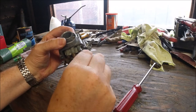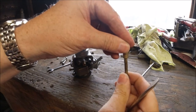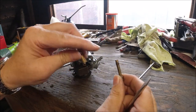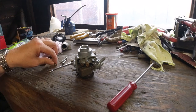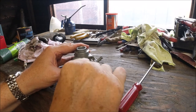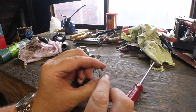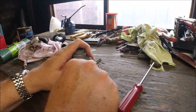The plunger basically does this — that's no choke — and as soon as it moves off, it lets air in and brings in fuel mixed with air through that hole on the side, giving you more fuel to start. Most jets are 45s or 50s — I'll have a look: this one's a 50. Then you've got your main jet in the middle and your pilot running jet, and depending on which Lambretta you're fitting, these will all be different.